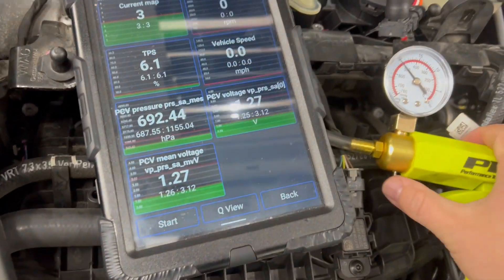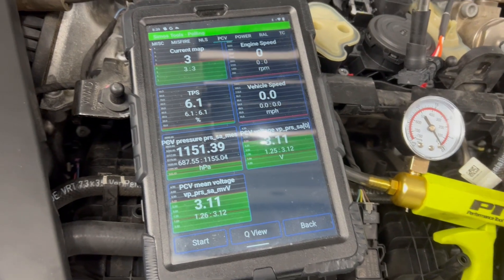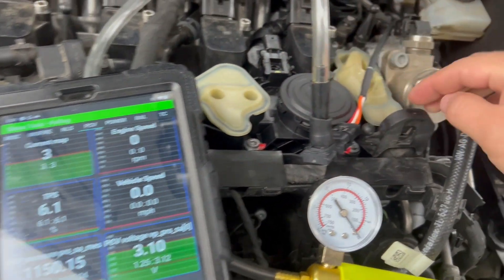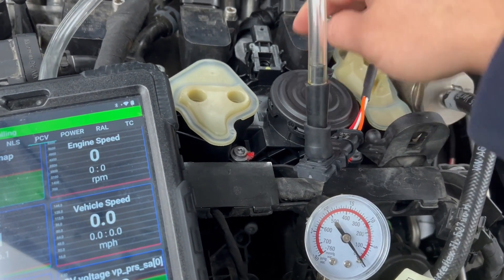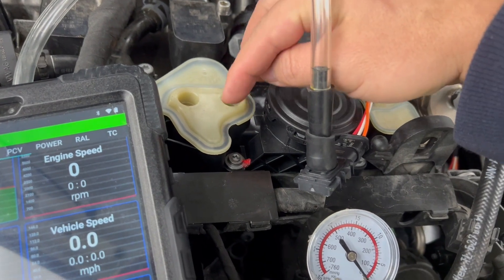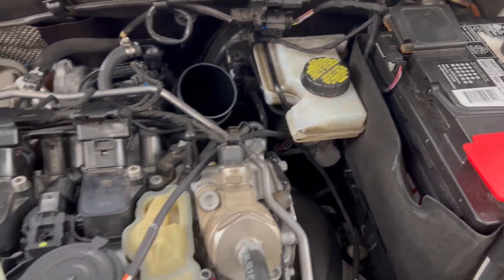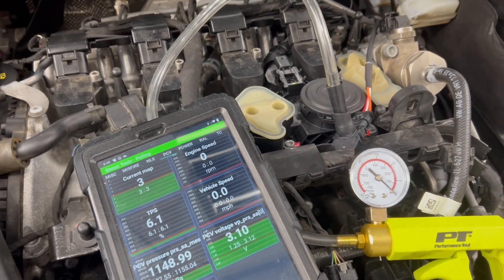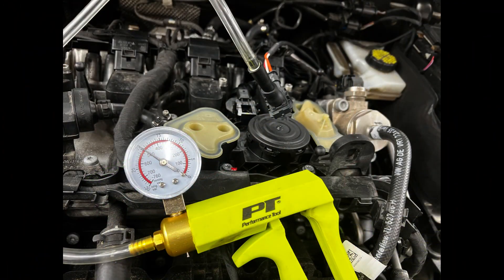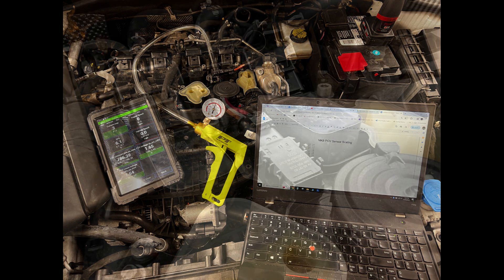I'm bench testing it here so I can scale the sensor because I'm not 100% sure of the voltage range. But essentially we are now going to be able to log the vacuum level inside of the PCV valve to know exactly how much is acting on the diaphragm — whether that is coming from the turbo inlet pipe or at idle as well. This is going to make testing of the Venturi and turbo inlet pipes a lot more effective, being able to log it directly and look at hard data rather than driving around with an analog gauge. I went ahead and pulled a vacuum on it and compared the gauge readings versus the raw voltage readings so I could map out voltage versus pressure accurately. And this here is the finished product.